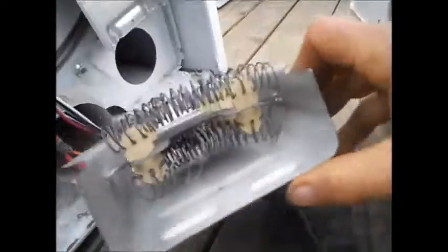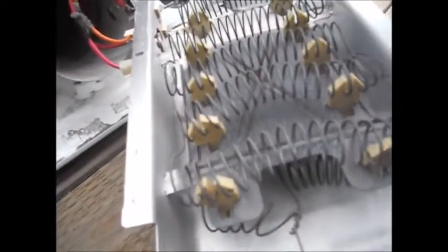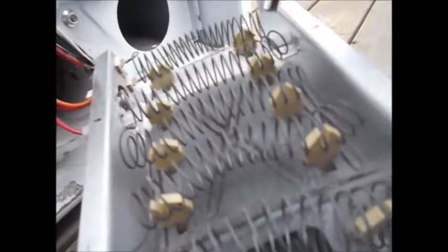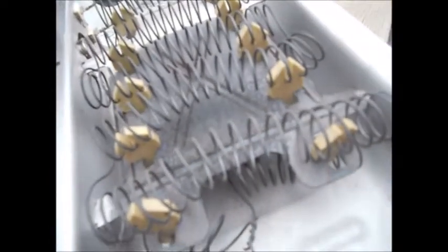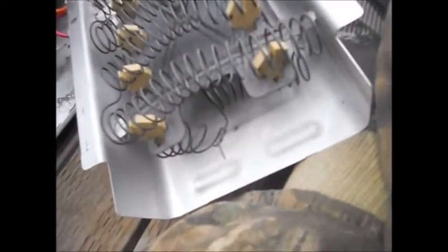See, this is the one — this is the one I tied. You can see how I tied it. It could be a good temporary fix. Sometimes these base plates get cracked. This one here I think is still usable. There is a slight crack in it, but I think it's still usable. What we're going to do is take this heat element coil off and then put the new one in place. Sometimes these ties can last for a long time, it depends. I normally clean these up real good before I tie them, but this one I'm just going to swap out because I don't want to take a chance on this coming back too quick. So we're just going to put a new one.